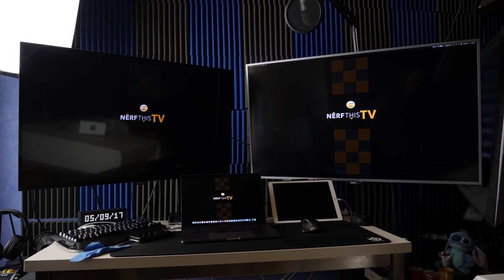A while back I did a video on using two 43-inch TVs for your computer setup. I had a Philips and an LG — they were 4K LED and worked pretty well with my Mac and PC. But the more I did video editing, I realized the LG's color was very dull. I found out it was mainly due to the HDMI settings — it has a deep black setting for its HDMI input — and using that dulled the colors down quite a bit. The LG was not giving me good colors for video editing.